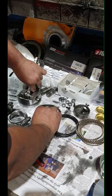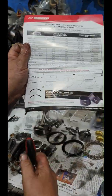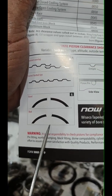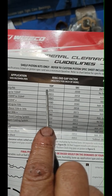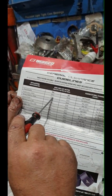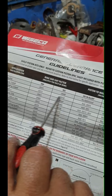I'm going to let this go — we're not going to put the top rings on because they're going to be gapped. We're going to actually machine the gap. I know the size we've got to do — I've already worked that out. On the ring instructions here, there you go — there's a picture of it. Remember I said facing up — it's actually written here, just to show people what it means. And here it shows you we're going to have to machine the ring gaps, and it's just telling you not to do it incorrectly. Here we've got instructions — it says street, naturally aspirated, 0.0045 is your minimum clearance per inch. So you've got to times that — it's a four inch bore, 30 thou — so we work it out with mathematics, it's around about 18–19 thou. But we're going to give it more than that because that's your minimum clearance. That's your second ring gap — only 5 thou.